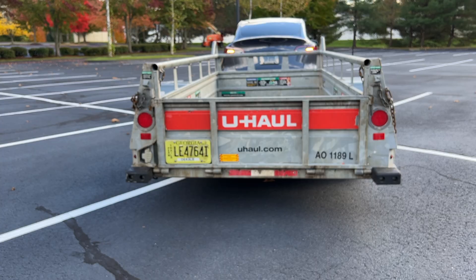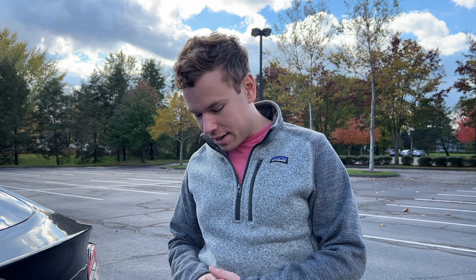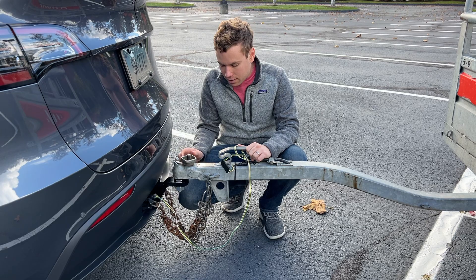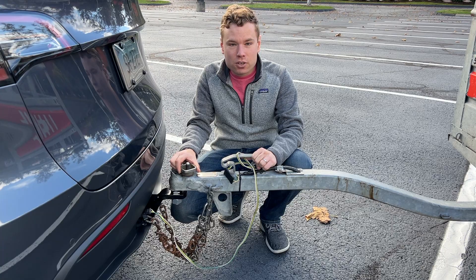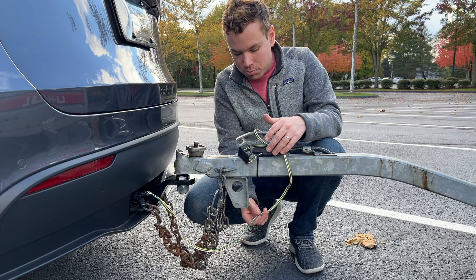Next, we'll talk about how to connect the trailer to the tow hitch. I've towed boats and a variety of trailers, but this might be your first time — that's totally okay. The people at U-Haul are great at helping you connect your trailer and testing your lights before you leave the lot. The U-Haul trailers use what they call an easy hitch that fits a variety of balls — you keep twisting until it's really tight and locks. Make sure you have enough play with the lights cable — not super tight, but not too loose either.